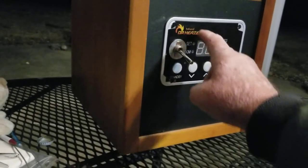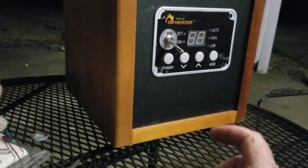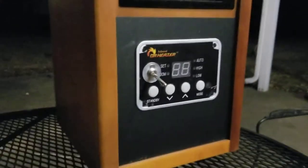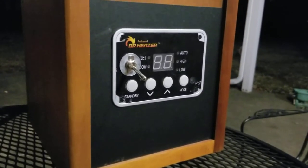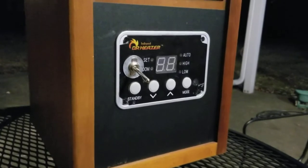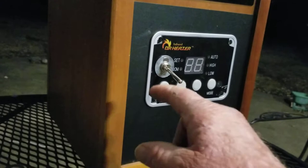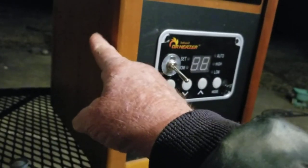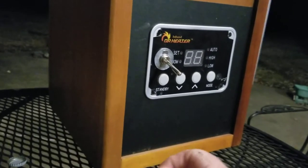What I had to do is, when you take this off, you'll see on the back of this that power switch — it holds it in. There are plastic clamps. I took wire cutters and cut them as close as I could get it, and she worked. It was pretty simple. When you go to strip that wire, hold the wire with one hand, because I pulled it off the back. It has a female to a male connector. I pulled it off the back, so I had to take the bottom and then take that back plate off inside to hook it back up.